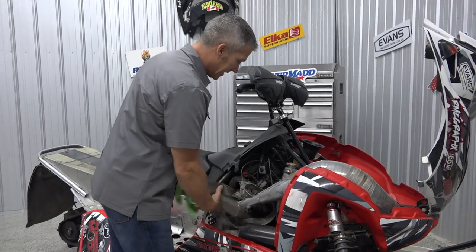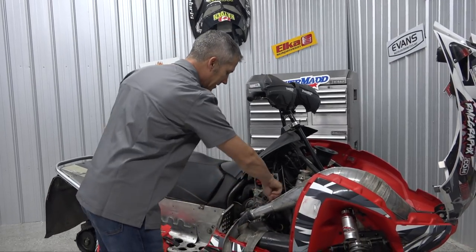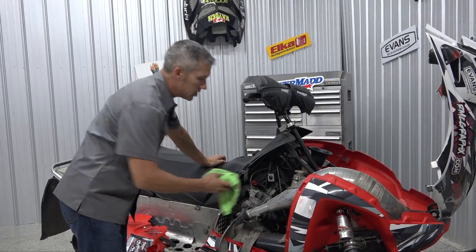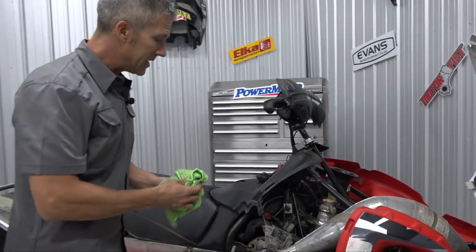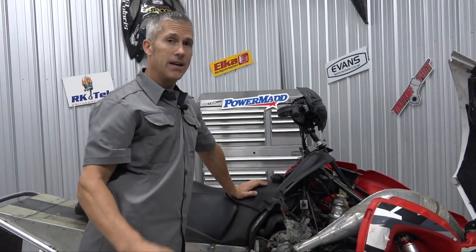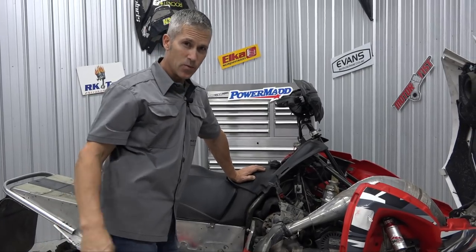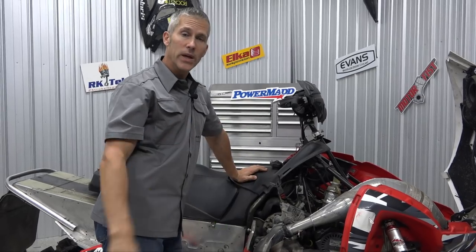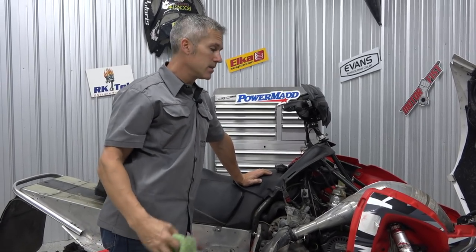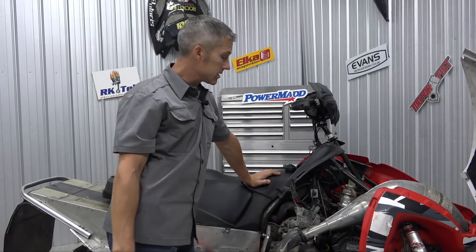This is why we look in here — this all needs to be re-wrapped, it's a bit of a nightmare, we're hard on it. Check your coolant level, make sure it hasn't dripped out. When you've parked your sled, it's a good idea to take a marker and mark your oil level on your reservoir. Sometimes that oil has a tendency to drip down and make its way inside your crankcase — maybe on top of a piston — and just sit in there. It's not good. You try to crank it over and some bad things can happen.